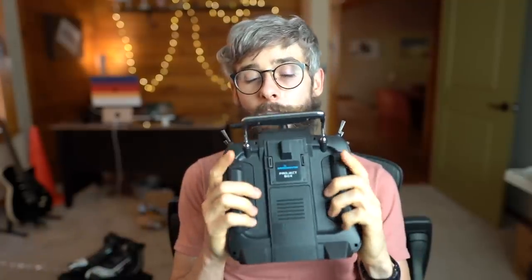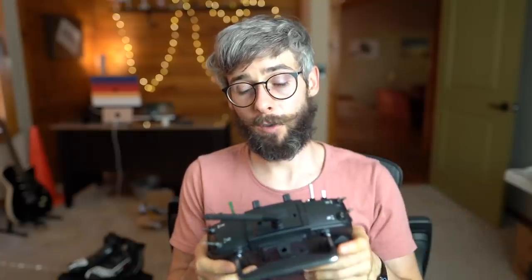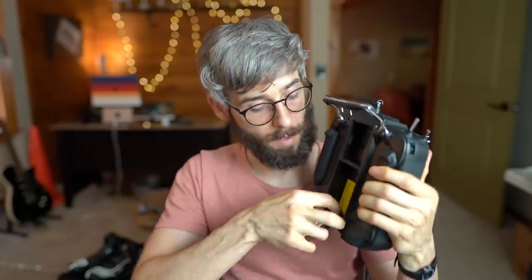I've already gotten some of these things apart. There are four Phillips head screws in the back and two 2.5 millimeter screws on top. Once you do that, go ahead and pull the module bay out and also pull the battery out, just in case something touches that we don't need it to and causes a short. We just take the power out and it makes life a lot easier — so pull the battery.